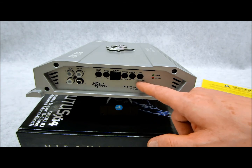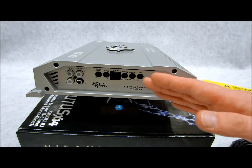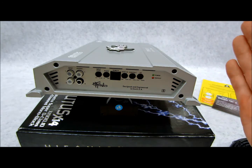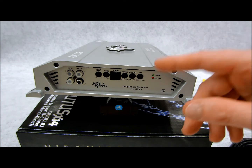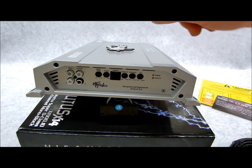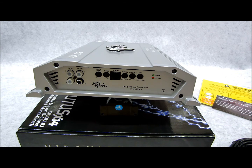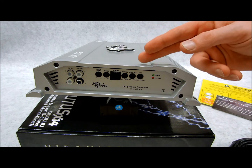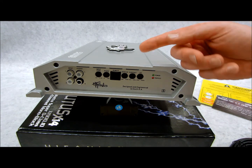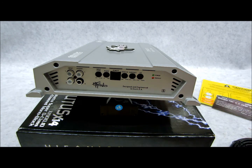LPF — low pass filter — ranges from 35 Hz on the low end up to 250 Hz on the high end. For a sub amp, 250 Hz is too high; I usually set it around 130–150 Hz. I typically control it from the head unit so I have ultimate control up front instead of going into the trunk to adjust it. If the amp is in a sophisticated rack and it's not convenient to reach, you're never going to use it properly, so it's better to overlap that feature and manage it from the head unit.